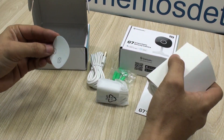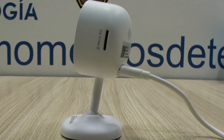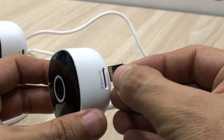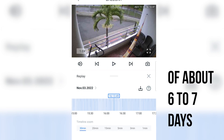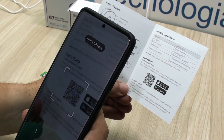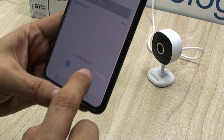The first thing that popped to my mind was how small they were compared with similar cameras such as the Blink Mini. You'll have everything at hand, even the reset button that may be way too easy to activate. Also the convenience of the local microSD slot, for which we had a lot of trouble using cards with more than 32GB capacity, even though the manufacturer states that 128GB is its limit. However, 32GB will give you a good recording cycle. One thing many will appreciate is that they are very easy to configure and you'll have them up and ready to record in about two minutes, even if you need to create an account, as it has the convenience to sign in with Google.